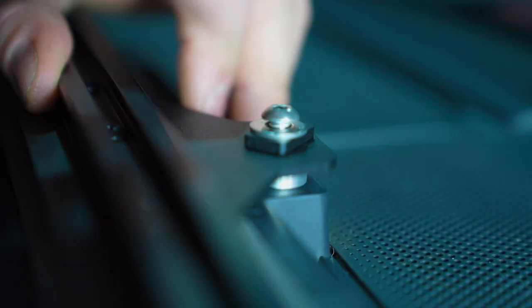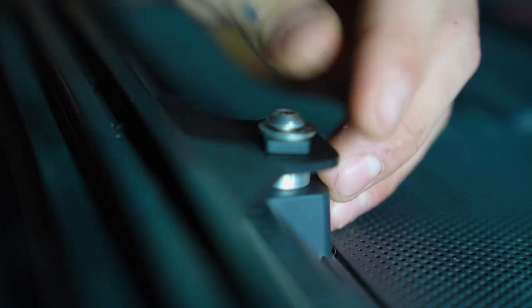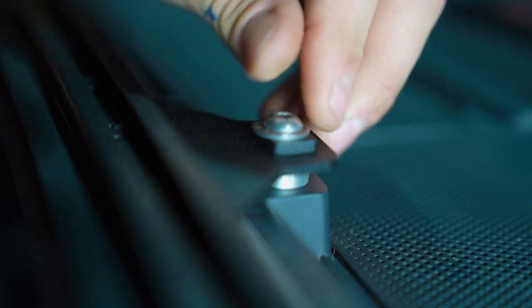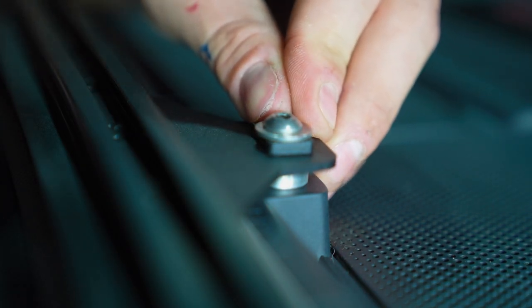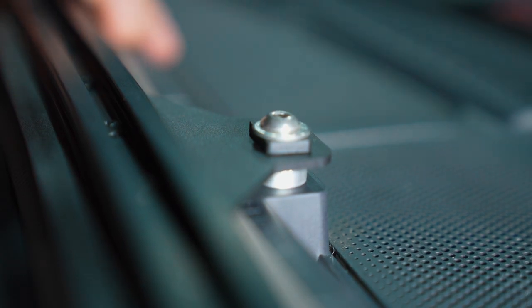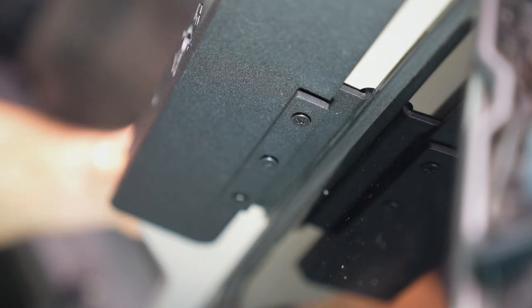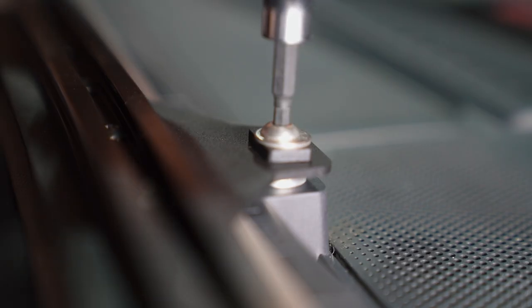Again, please take note, proper orientation will be as follows: 1/4-20 screw, flat washer, black aluminum spacer, dash mount center flange, round aluminum spacer, dashboard. Very specific, guys, don't miss that step. Now that all screws are properly engaged, ensure proper alignment left to right, then fully tighten all the screws.